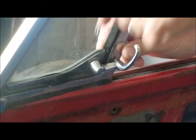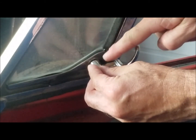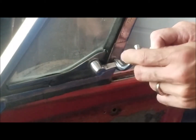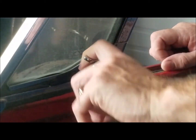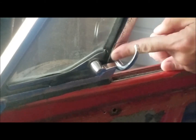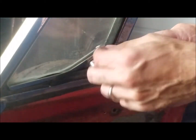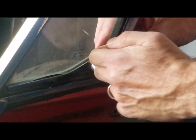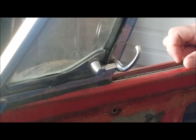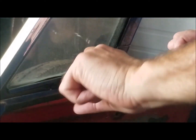When you put the new piece on, you want to make sure the orientation is proper. There's a little slot that the pin goes through on that post. You slide it on, make sure it's lined up, and then tap in your new knurl pin that the part comes with. Now they have a tendency to break — it's usually from people pulling on them like this, so they'll snap off here. I've seen a few snap off from the tension being put on by the quarter window, but most of them snap off right here. This car had both of them broken right here, but as you see, they work beautifully with the car.